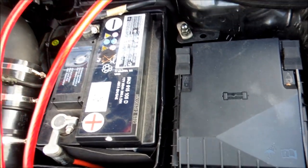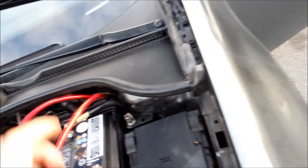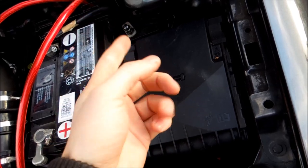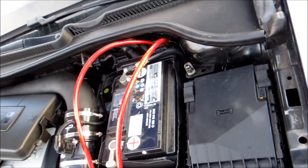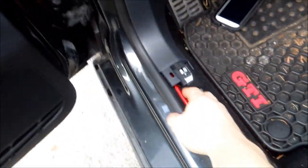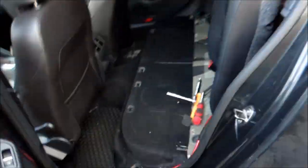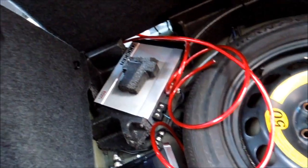I've got tons of wire here — even more than I'll probably need, but I want extra for the fuses up here. How I got them up here: when I was looking through that window once the plug is out, there's like a crevasse there. If you aim for it with the wires, you'll see light coming from up here. I just forced the wire up and it slid right up the firewall and I pulled it out — super easy, you don't even need to fish it. I tucked the wire up and in here and put both power wires coming down here. Since I'm running two amps, I've got both of them, and then this comes down over to here. I've already showed you how to take the trim off.